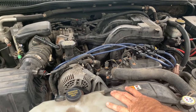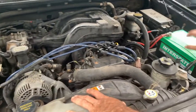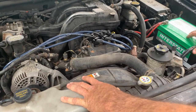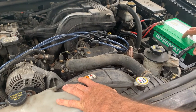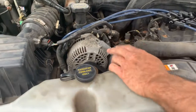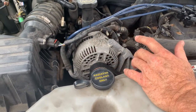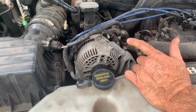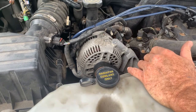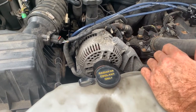This is the Ford 4.0 single overhead cam. They put a newer battery in it recently — it kept going down and they didn't know what it was doing. They figured the battery was old so they replaced it about six months ago. But it turns out it's the alternator. To charge your battery properly it's supposed to have like 13.8 to 14.2 volts. This one's reading like 12.8, so it's not properly charging your battery and after a time it goes dead.